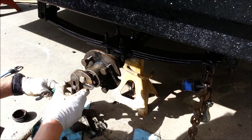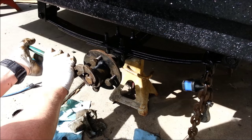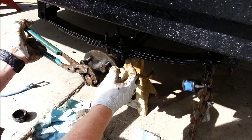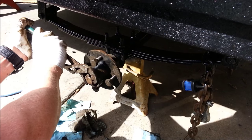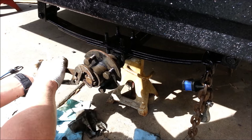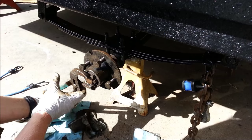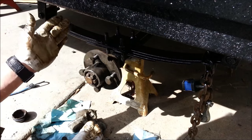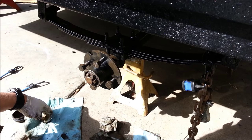That puts metal to metal where you want it, and then you can back it up to an appropriate notch. I've got no play — a very, very tiny amount. My cotter pin will go straight through the middle. You want to be on the looser side. You can't always get it perfect; if this one were perfect it'd be about right here, but I can't get a cotter pin there. So you go to the next looser spot — loose is better than tight. Throw the cotter pin in and we're done.